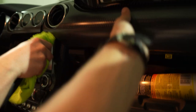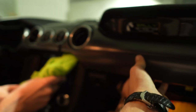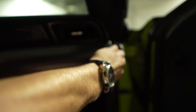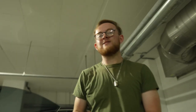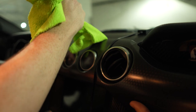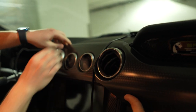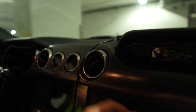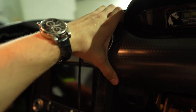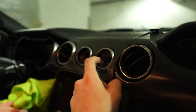We have the trim tool right now, hopefully this will make it easier. Oh yeah, it's coming off — gotta be careful with the clips though, from the back. One piece is out so far. You have to start at the corner to pry. It just clips in but it's really really in there. This was a pain in the butt, not gonna lie, and I might have to glue it back on because the clips sounded like they popped.